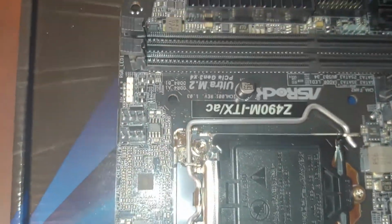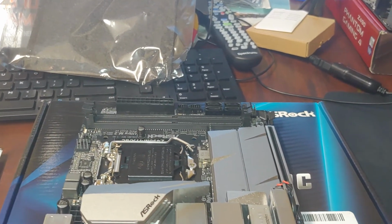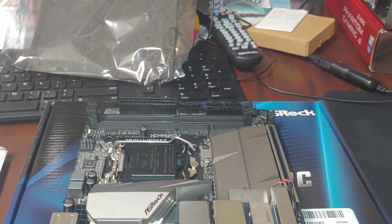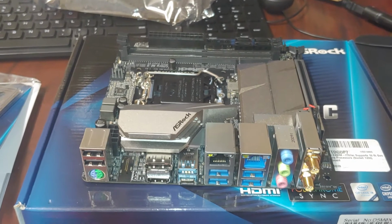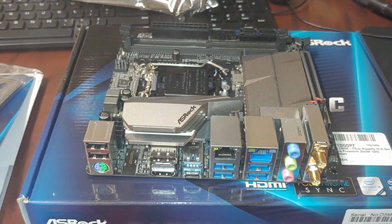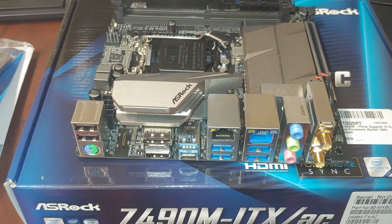So that's going to do it, folks. Hopefully you got something out of this. I know it took a while for that. We talked about the different types of CPUs. Now RAM wise, like I said, you're going to want to go to the website. They'll tell you what kind of RAM is compatible with this, right? So you go out and buy that awesome 4400 megahertz RAM, but you know what? You may not get 4400 megahertz with it if it's not compatible, okay? So keep that in mind.